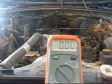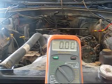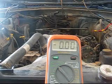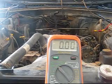In pin A8 there you have 0 resistance. That is exactly what you're looking for. So you're measuring the resistance between pin 1 and pin A8 on that one. You have 0 resistance there, you're good to go. Let's move on to the next step. If you show anything else, you need to check that circuit,